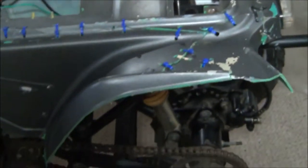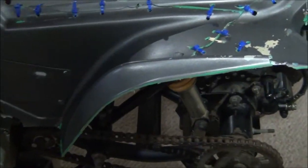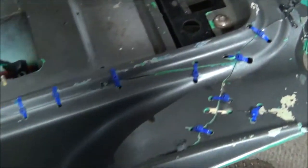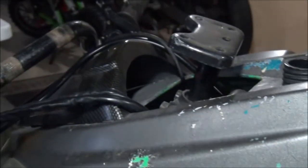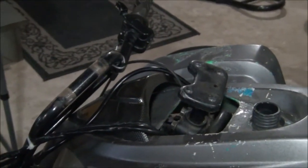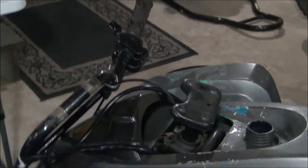The fairings were cracked, and they obviously cut off this other fairing. It must have been cracked pretty bad. So I'm going to see if I can plastic weld it from the underside, and then when I wrap it, will it make it more presentable? So we'll see. So unplugged our back light, and unfortunately, this thing's not strapped on by too much. I have one rusty bolt right here, and we have two bolts on the sides. We'll take these two bolts out and take the plastics off, and we'll see if we can finagle those handlebars out without taking something off. Let's try that.